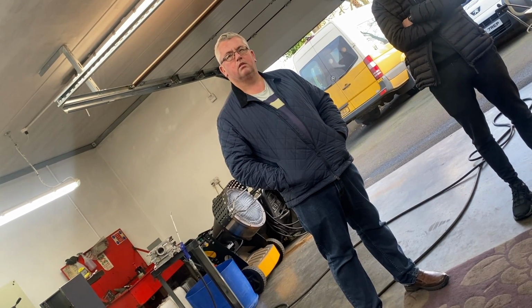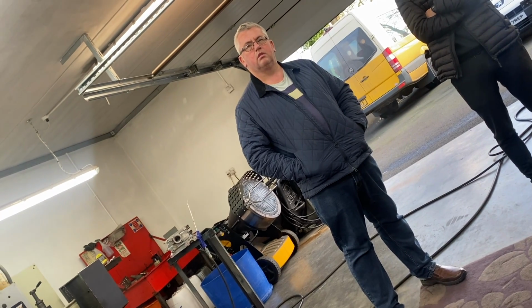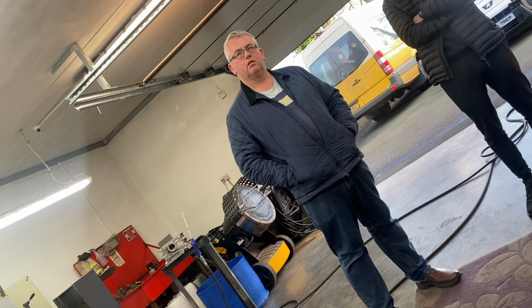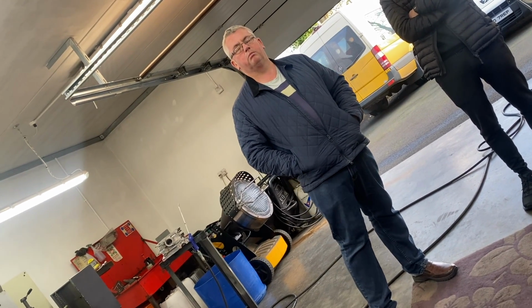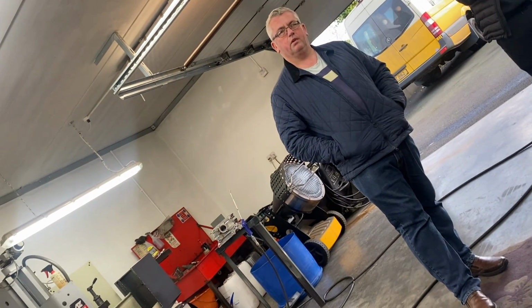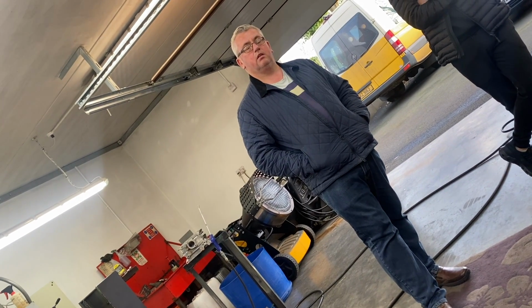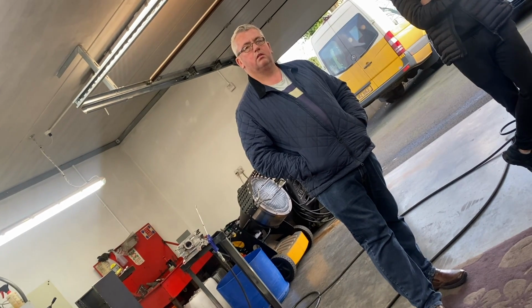And what thickness is it? Thickness is 1.3 mil. Same as the XE. Same as XE, but you can drill the rivets out on two of them and reshim them to whatever thickness you want. But they come 1.3. They come 1.3. Right. So we'll always use that, and I'm talking 3 bar of boost, and you'll never blow that gasket. Right. Athena, I ran Cometics.